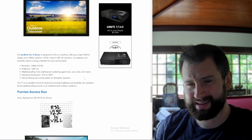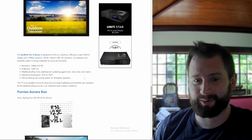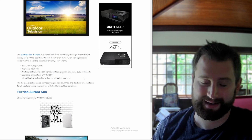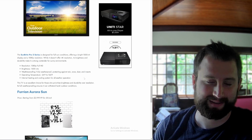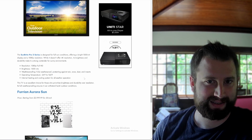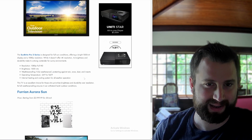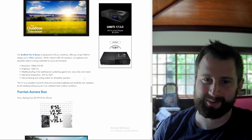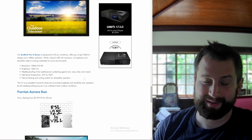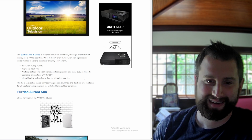And of course, these TVs sit out in full sun, they really do bake really quick. So of course, they obviously get a lot of heat going right away. That's why I always like to say, guys, I'm not a huge fan of full sun installations because you can buy the best TV, the best weatherproofing TV out there, and you get water just in one little piece of that seam there, something happens there, and that can take down the whole TV very quickly. The sun and rain are not forgiving at all. Mother Nature is not a nice neighbor to have when you're putting outdoor TVs out there.